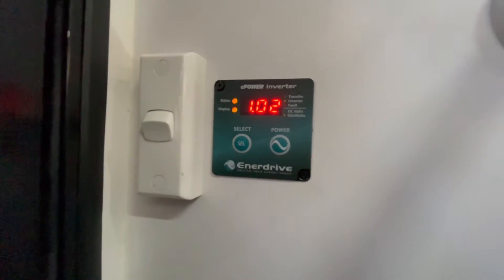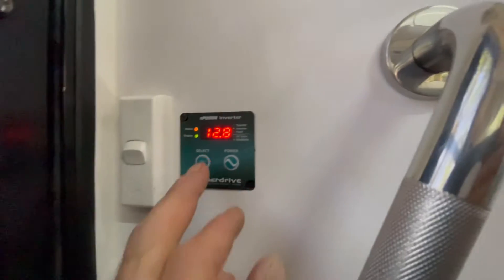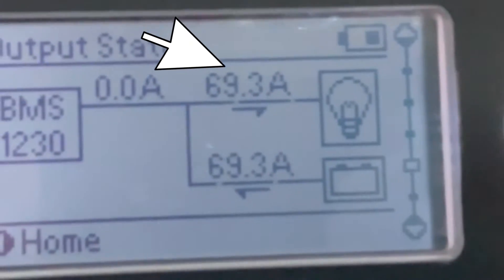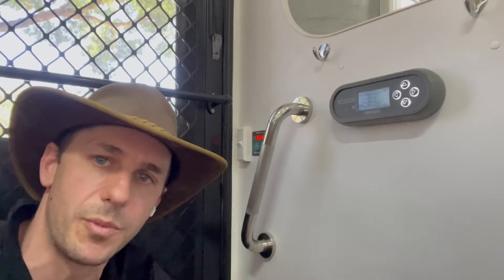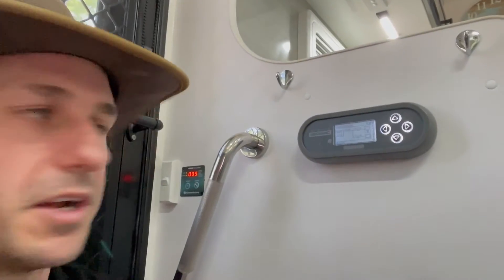Because the Redarc shunt is monitoring everything, we're pulling nearly 70 amps from the battery — you can see the loads and battery readings are identical, so power is coming out of the battery. For those of you adding a big charging system on a Redarc Manager, it's all doable — just remember it won't show under solar because you're not using that solar input for the roof array anymore. That solar sign on the Manager is just for the side Anderson plug for a portable panel. All those other charge controllers are still monitored as a total via the shunt.